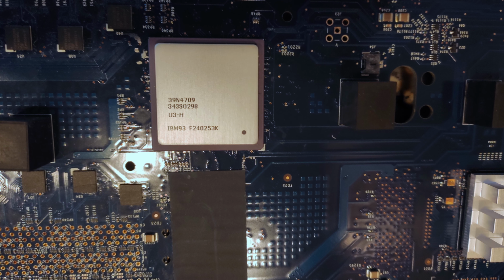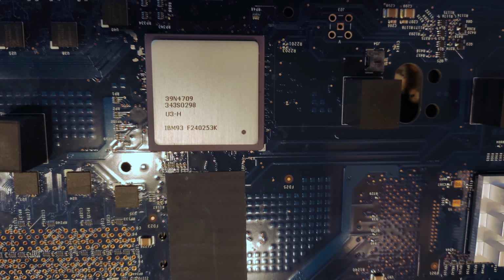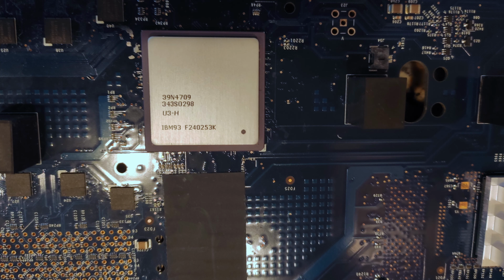But over time, as the chip goes through a lot of thermal cycles and the thermal paste starts to dry out, this chip can get very, very hot. Getting stuck at the Dart enabled line at boot suggests that there's likely something wrong with this chip, and that will keep hanging the computer at boot until it's either reflowed or replaced.